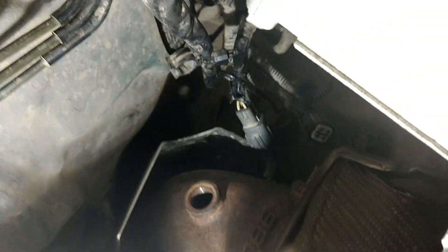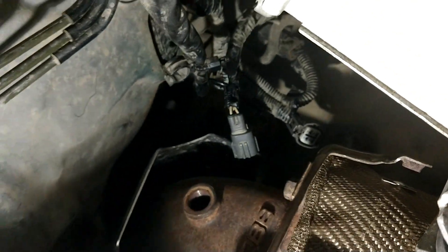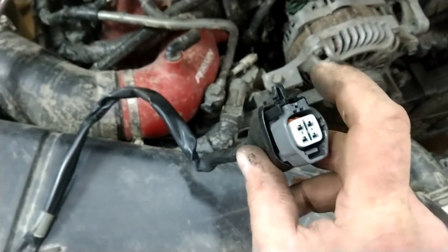This connector here is the one that connects to the ECU. The female plug on the right goes through the firewall to the ECU, and this one goes over the transmission and back to the rear O2. That wire is basically an extension cord — on one side it plugs to the ECU, and on the other side is where your rear O2 sensor actually plugs in.